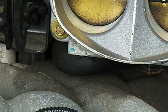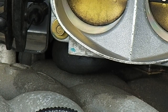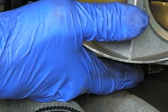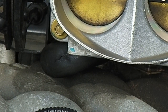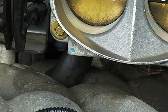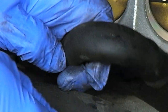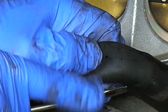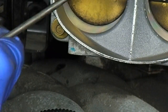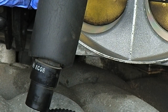I'm going to pull this thing off of here so you'll be able to see it, and then I'll show you also the way to get these plugs out of here without damaging anything. I'm going to pull this whole PCV hose assembly out of here. Here's a close look — see this split right here? That's where the vacuum leak is. It's connected to this hose and this valve that goes into the valve cover. What that does is it sucks crankcase vent fumes out of the engine.